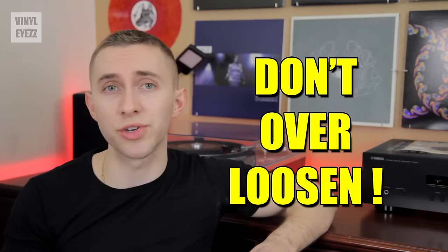Now you could say, what about the all-in-one turntables that have the turntable, preamp, amplifier, and speakers all built into one? No, those are not good — they're basically sacrificing quality for convenience, so I would not recommend you ever buy one of those. If you want to get the most out of your vinyl audio setup, buy the parts separately. The very last thing you have to do is plug your turntable's audio cable into your next audio component — whether that's the preamp, amplifier, or the speakers — placing the white connection into the left channel and the red connection into the right channel. Then plug the AC power cord into the nearest electrical outlet, and you are completely done.